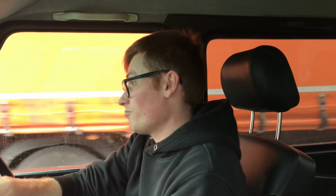So all that you're really doing by dropping the revs right down is bogging it down. You're getting that turbo boosting up when it's unnecessary. It doesn't really need it. And this is very sensible on fuel, and it's nice and quiet in the cabin even at 70 miles an hour. So there's absolutely no reason to go, oh yeah, I want the tallest ratio diffs, I want it to be doing 500 RPM at 100 miles an hour. You're not really doing the engine any favours there. It likes to flow air. That's why you see all these high RPM 606s, because that's what it's designed to do.